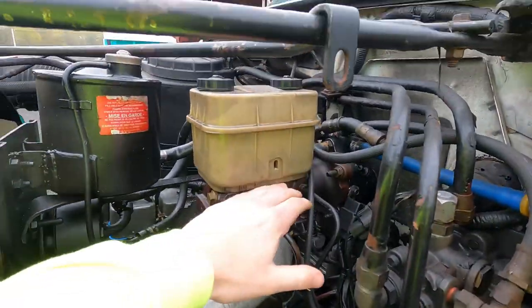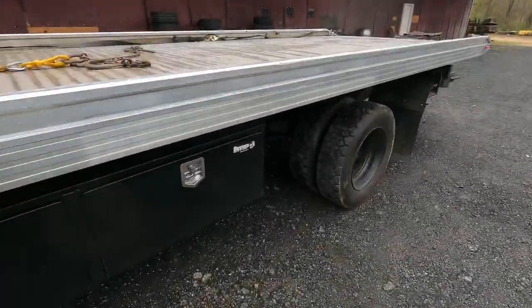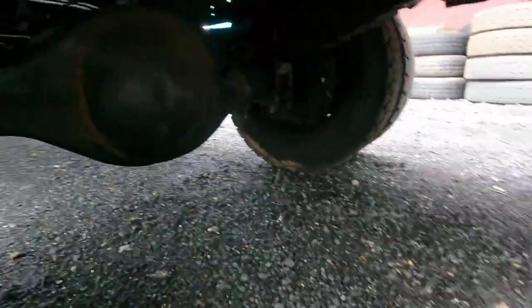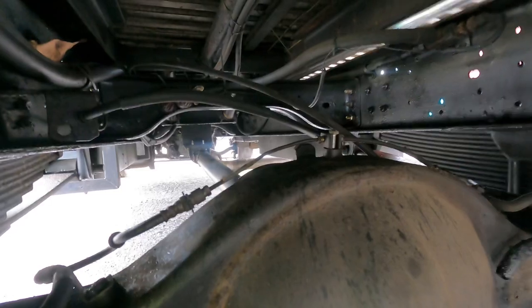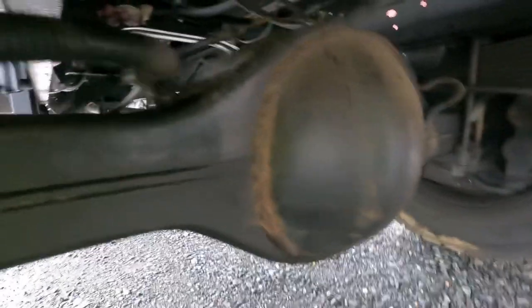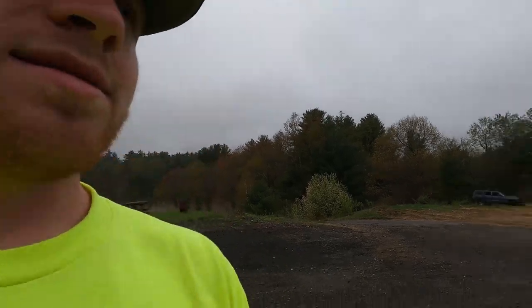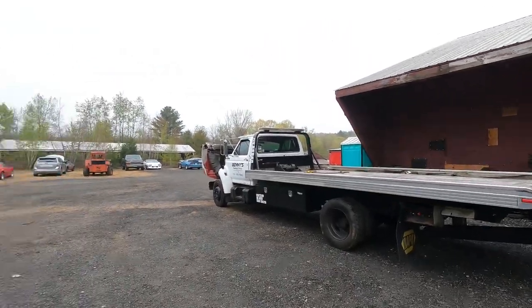The master cylinder hydro boost setup is original — I did not have to swap it out. As far as the brake lines, all I did was use the original T-fitting from the F800 truck, bolted it down to the new axle, and ran brake lines from that fitting to the hoses. The hoses on this axle are female threaded on the other ends, so I just ran brake lines to them. All together, a real simple swap — and that, my friends, is how you delete Lucas Gurling brakes and swap an axle in a medium-duty F-Series truck. Any other questions, comment below and I'll answer them as best I can. Thank you.